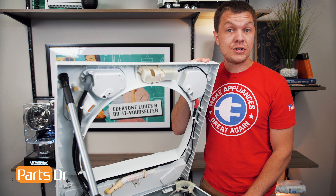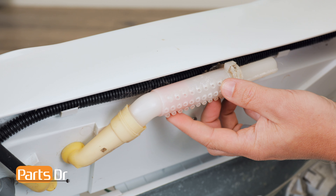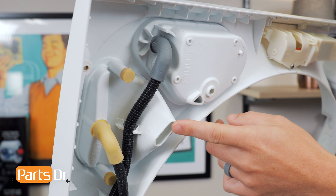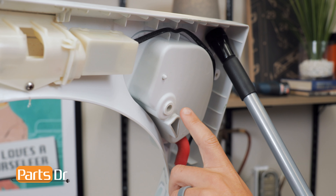Inside of the nozzle is a plunger that moves with the water pressure against it. If the water pressure is high, more holes in the nozzle are exposed and the back pressure on the dispensing valve is less. And if the pressure is low, fewer are exposed, ensuring the bleach and detergent dispensers take priority.